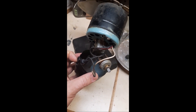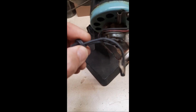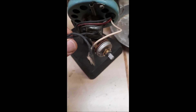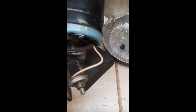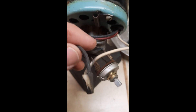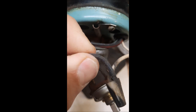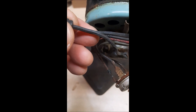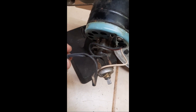We're going to try a new wire just to see if we can get the motor to turn, then we'll continue the project. One thing you always want to be careful about before you start disassembling: here we have two black wires — basically lamp cord — but one connects to where a white comes in and one connects to the slide-on connector. The wire going to the white appears smooth, while the one going to the switch has ribs on it.